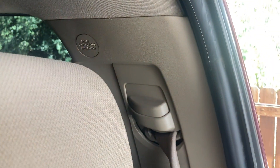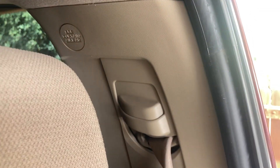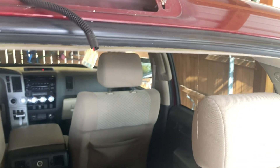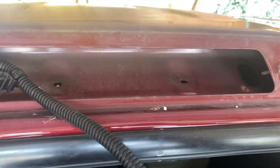Here's how I'm getting to this. There are videos that show you removing the plastic panel on both sides by the seat belt, but I'm not going to do that because I already have access through here since the light blew out. The light is held in place by 10 millimeter nuts on the end of these studs. So what you got to do is roll the back window down — with the back window down, you have access through this hole to the plastic tabs that hold the headliner in place.